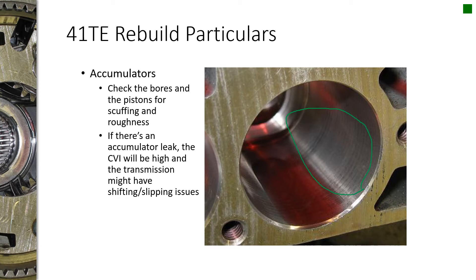If you leak fluid out through there, that's fluid that's supposed to be going to apply the clutch. It's also fluid that's on the opposite side of the orifices. Any leak on the clutch side of an orifice is going to cause serious problems, because now the clutch is competing with the leak to get fluid in there. It's already being squeezed through an orifice and some of that's being leaked out. So we want to minimize or eliminate leaks on the clutch side of any orifice.